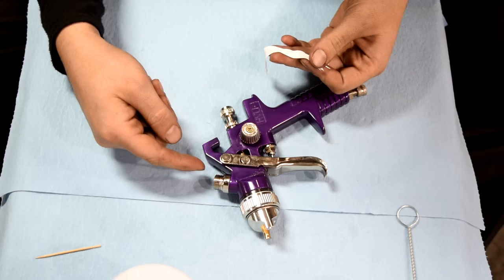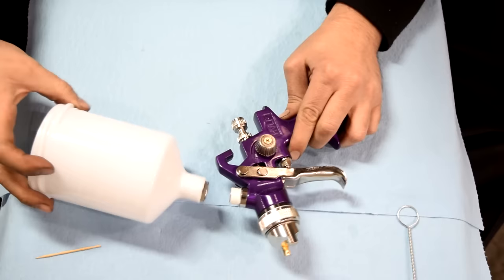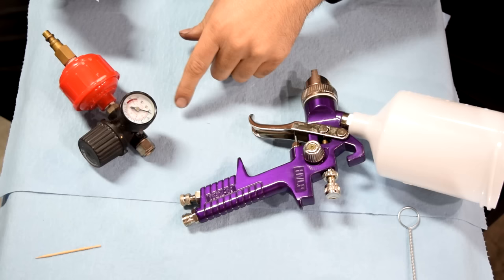When you're putting on Teflon tape, you want to make sure you put it in the same direction that you're going to be screwing the part in, because if you go the other way around and go to screw this in, you're going to just unwind the Teflon tape. In other words, just put it on clockwise. Then we can screw on our cup.